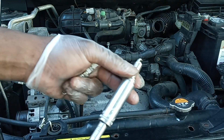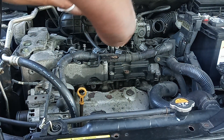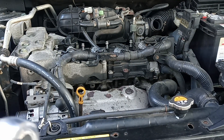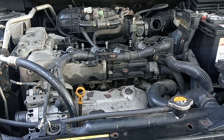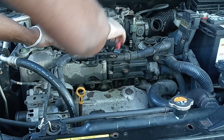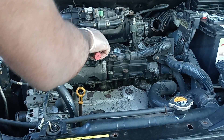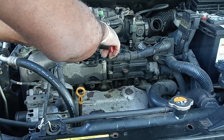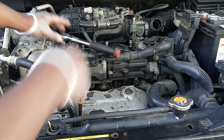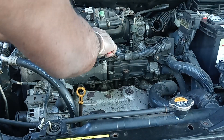What I usually do is drop it down 40 millimeters, take your time. Very important — you don't want to over-tighten the spark plug. First make sure it's seated right, then continue until it's snug. As soon as you feel it getting tight, give it just a little torque and then stop. You don't want to over-tighten and mess up the thread.